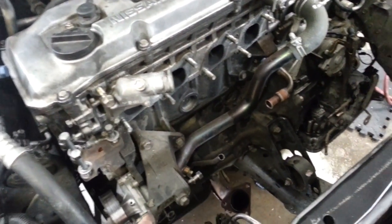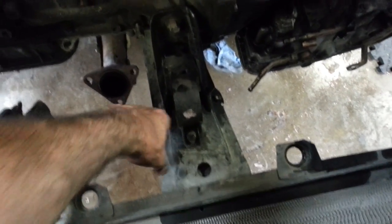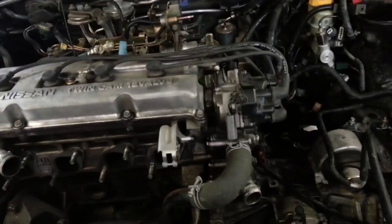Here it goes — I'm going to try to pull this engine. Got everything disconnected: exhaust, alternator, radiator, all the wiring. I took the axle shafts out and put the stress bag on real quick. I'm doing it different this time — I'm not going to disconnect the lower crossmember or take the exhaust off like I usually do. I'm going to try to leave those on. I'm just going to remove all five bolts holding the tranny mount on and then the four bolts on the tranny. I've got the Altima up on jack stands, so I'm just going to put the hoist on it and see if I can pull this out the top.